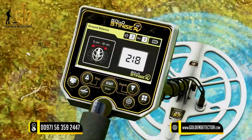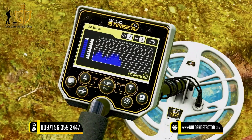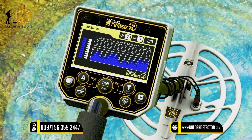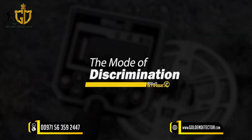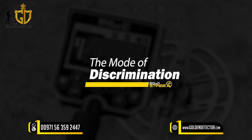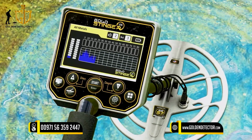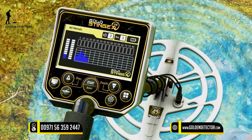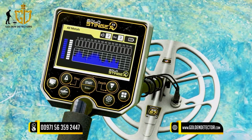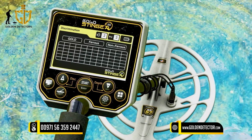We can also access the All Metals mode by pressing the Systems button to the right of the main control panel. 2. Discrimination mode. After detecting the presence of metals by using All Metals mode, for example, we can then switch to Discrimination mode by pressing the Up/Disk button located on the left of the main control panel.